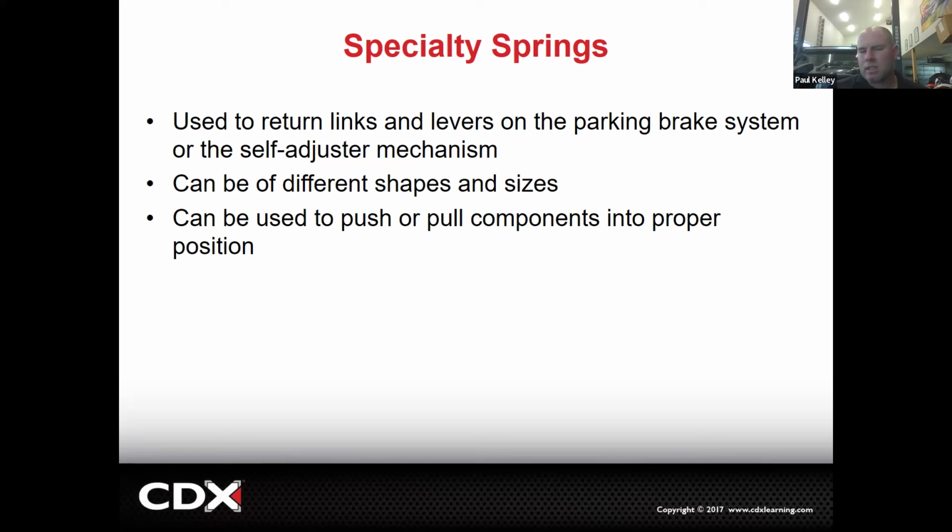is best practice would be to do a hardware kit. The brake shoes typically will last close to 100,000 miles, which may be somewhere between 5 and 10 years. By the time you're doing brake shoes, it's probably a good idea to do the springs, especially when the hardware kit could be about $20. I just don't see it making a lot of sense to not replace them.